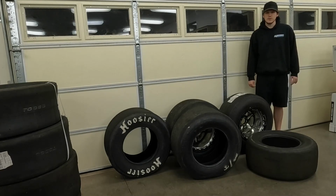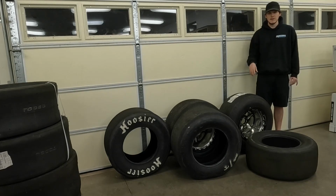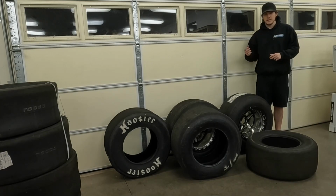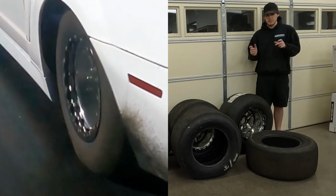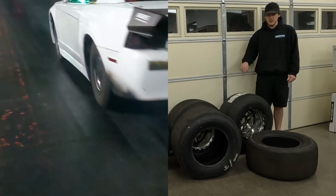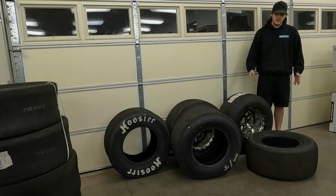That's kind of something that you can only really see in video. If you're just looking at data logs, it just looks like you blew the tires off. But if you have good video, you can watch the tire and see when it starts to wrinkle up a lot, and then you'll see that it wrinkles up so much that it starts to pull the contact patch up off of the track, and then you will go into a spin there. And sometimes it'll even start to shake in that time as well. Usually it will wrinkle up real bad and then shake a little bit, and then just go into an uncontrollable spin.